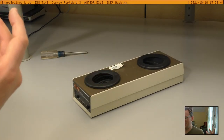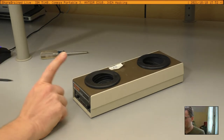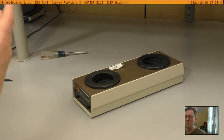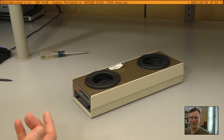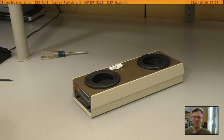But yeah, for those of you not familiar with modems, I suspect most of the people I've seen so far know about modems. Back in the day, we used phone lines for computers to communicate, and they modulated signals slow enough that you could actually hear them. Wi-Fi signals now are many megahertz wide, and our hearing is only 20 kilohertz wide, so there's no possible way that you could turn a Wi-Fi signal into audio at the rate that it normally happens and be able to hear it. But at 300 baud, you could totally hear it. In fact, it was designed to go over a voice telephone line. So by very definition, you could hear it because it was using a technology that was intended for acoustic use, for voice and ears and all that stuff.